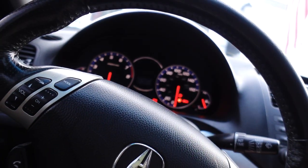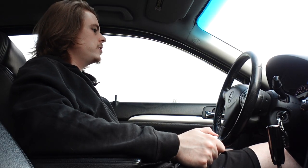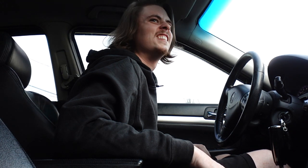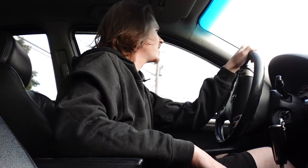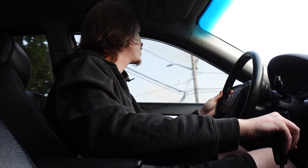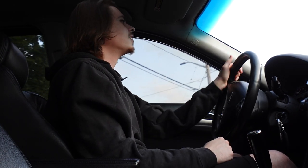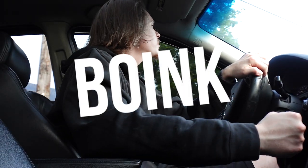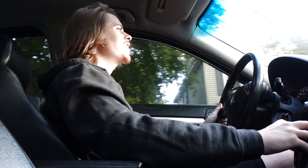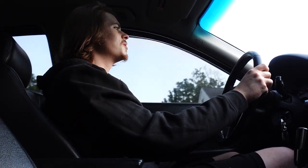The car is done and ready to drive. Alright, moment of truth - maiden voyage in the TSX with the new control arm. Hopefully it drives well. That's not good, I'm hearing a noise. Still hearing something. It feels a lot better though - it's not pushing the wheel around as much. I was definitely hearing a little bit of a squeal. Something just settled so I think the ball joint might be starting to go, but the arm was a huge improvement.